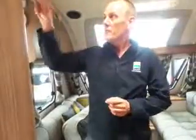On the Boost, what it's doing is drawing all the heat away from the boiler to warm your room up. So on the Boost on the fan, the water's going to suffer. You're drawing all the heat away from the boiler. If you remember on the water one, which I didn't quite explain, if you had the Boost option, I'll click on the Boost water. That's water Boost now. What that will do is concentrate all the heating on the hot water, taking your heating. It will then shut the fan off. The fan is not going to operate until it gets up to temperature on the water, and then it will allow the fan to come on.